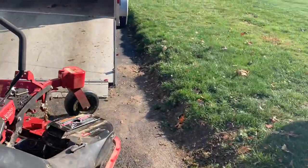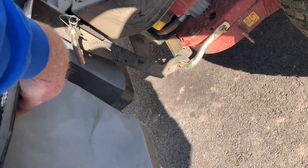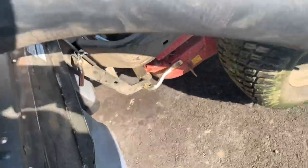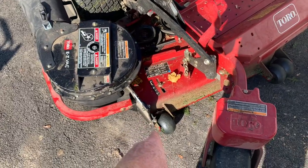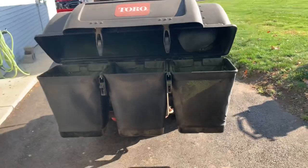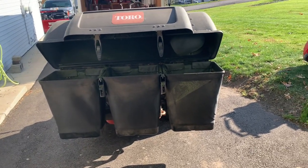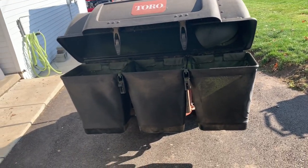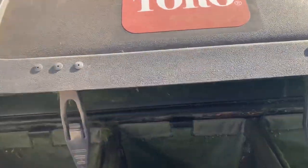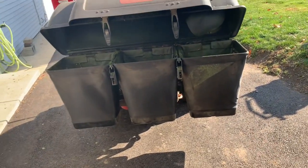What I do is from the seat, I'll turn around and look, and move the mower. If this bag is still moving, I know I'm still good. But once it fills up, it won't move anymore — it will press up against its back and be kind of full. The secondary sign is blowout: as soon as I see blowout coming out the front side of this deck, I shut everything down because that's definitely a sign that you're full and there's back pressure. So that's something to look out for.